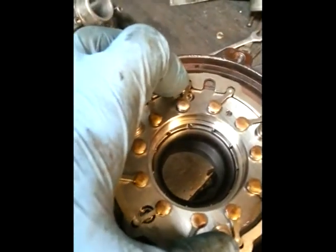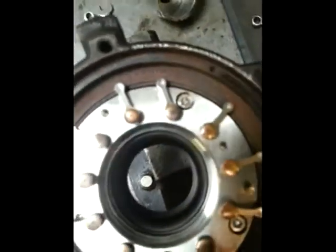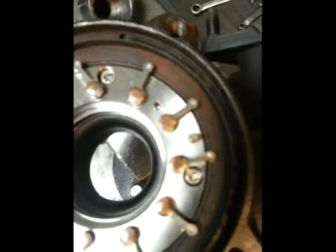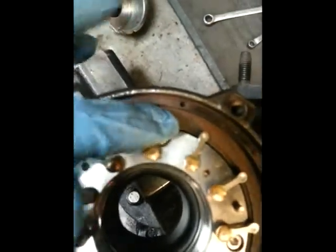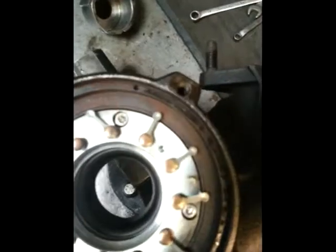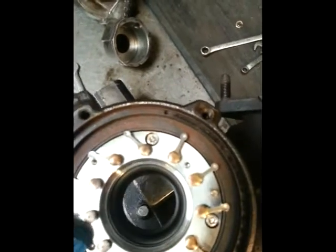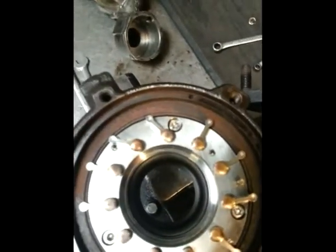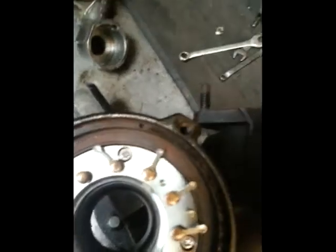What we're going to do is take the vanes out of the housing and then rebuild it. To get the vanes out, there are three small bolts holding them in — sometimes they'll be a T25 Torx or a 4mm Allen key. Get a tight fit and use a small extension, then give it a good three to four cracks with a hammer just to loosen the threads a little bit. Loosen all three, work them back and forward with a little bit of WD-40. You do not want to snap those off, because if you do you're in big trouble — there's no way you'll ever get them out and you'll probably need a new housing.